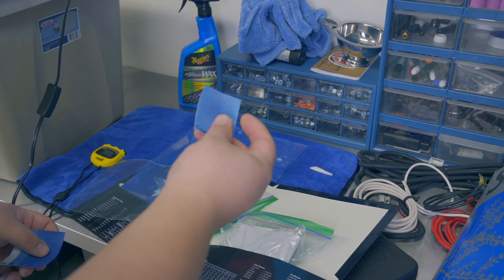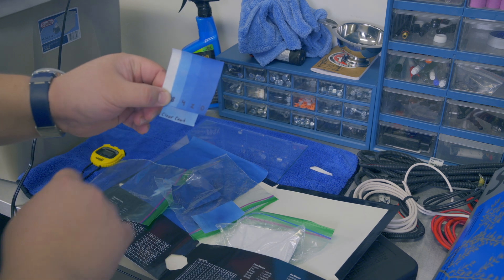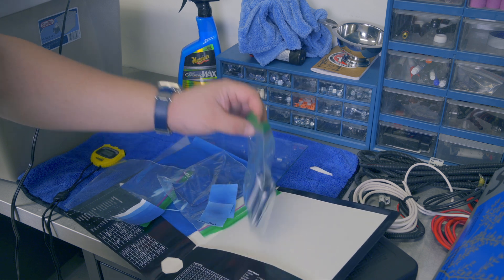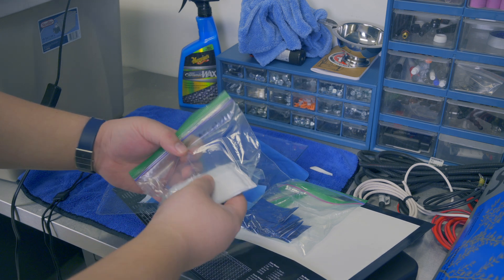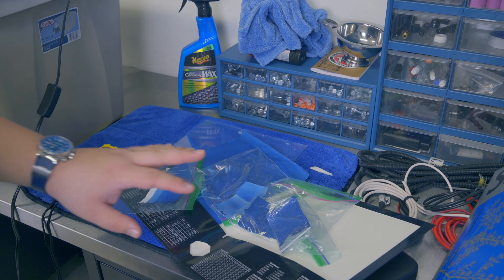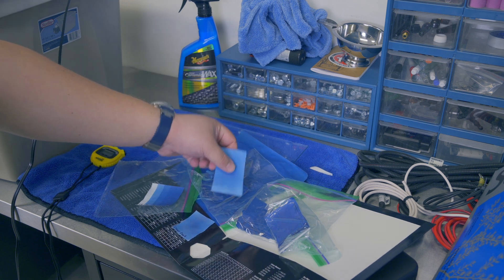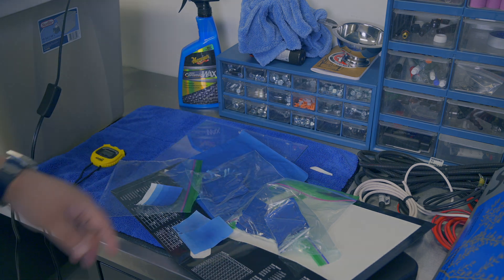This one here is clear coat, and as we can tell it's right up there with an 8 - clear coat does very well. What this is showing me, with all of these products I've tested, is that waxes in general don't really provide UV protection - not like clear coat and not like SPF sunscreen. The sunscreen is obviously not as good as the clear coat, and I'll talk about that too.